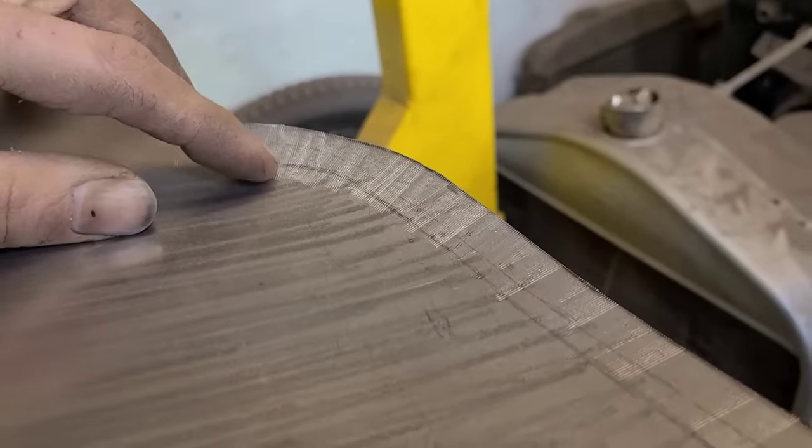I'm gonna start by making this piece, which on the other side is completely missing, but it's basically just a 90 degree bend. And then we'll join it to the rest of this panel right here, and we'll just weld that in as a seam. Okay, I bent a piece for each side to 90 degrees there. And I'm gonna cut all this garbage out of here, and then I'm just gonna plug weld it right like that. And that'll be the start of our inner piece. Okay, we got this little angle thingy welded in both sides there. That's all looking happy.